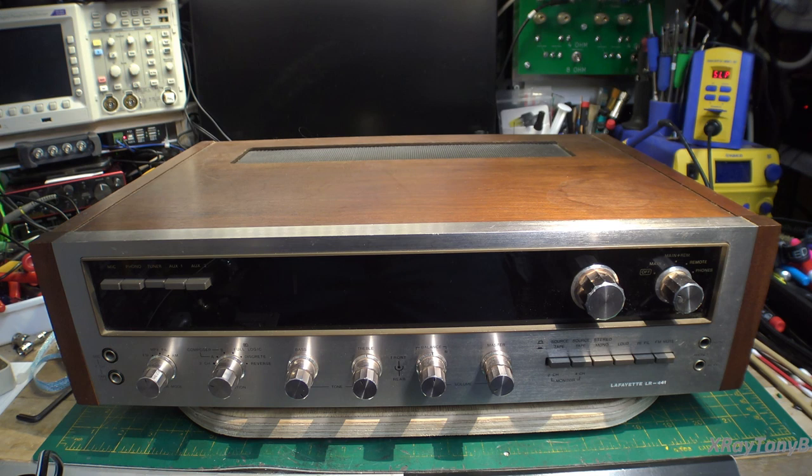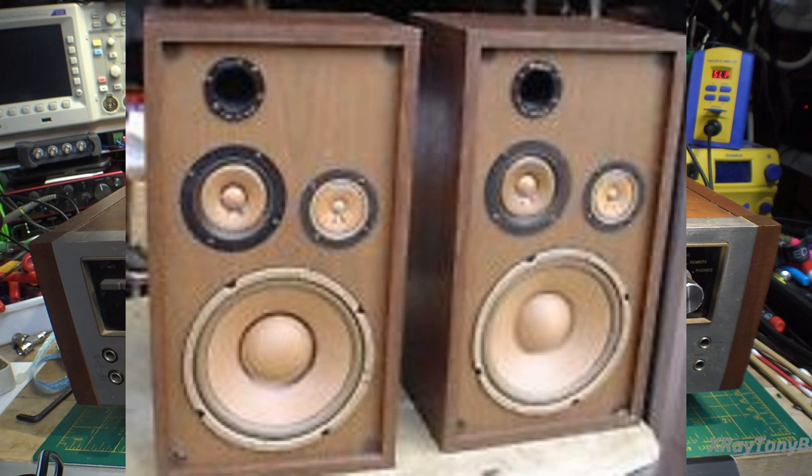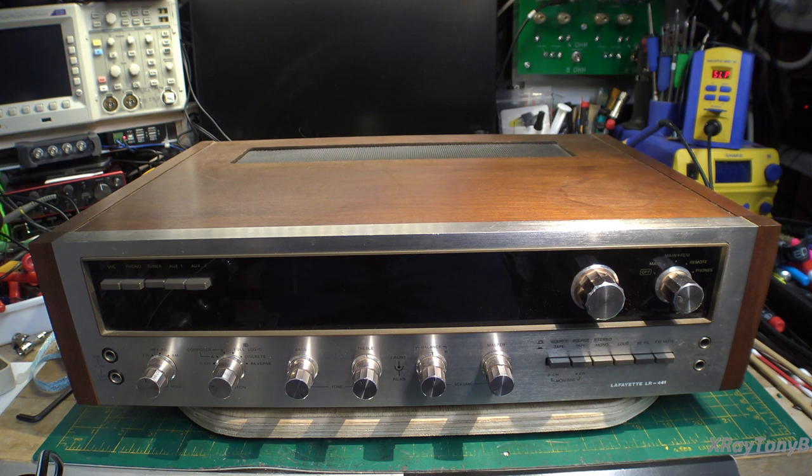The LR111 is the smaller version of this — only rated at about 7.5 watts per channel, but it got incredibly loud for how low power it was, and it was a very good performing receiver. At the same time, I saved up and purchased a pair of Sonics speakers, kind of the low-end version of Pioneer. Three-way speakers with a 10-inch ported woofer, a four-inch paper cone midrange, and a two-inch paper cone tweeter. The crossover consisted of just two capacitors, but they really sounded nice.